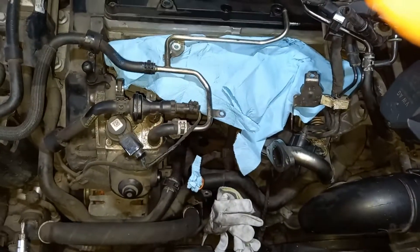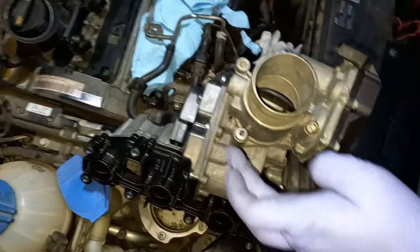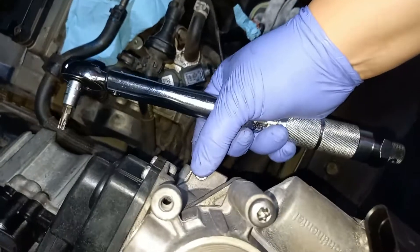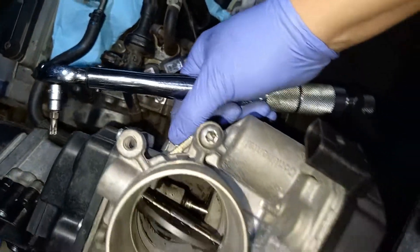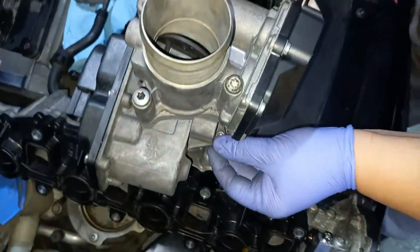The anchor plate in place. 10 Newton meters is needed to tighten the bolts — we have one here, one over here, another one over here, another one on the bottom side, and one more over here.